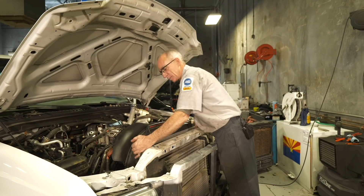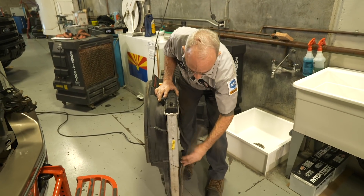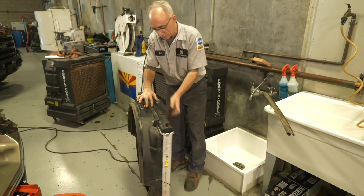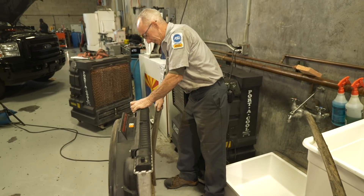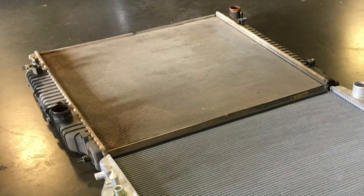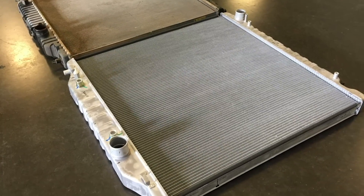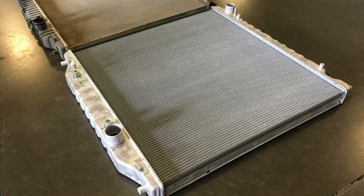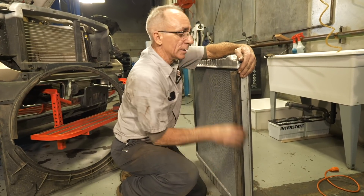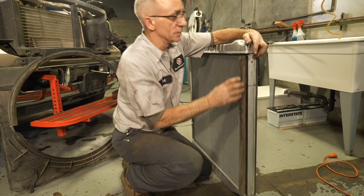We're going to upgrade our radiator — take this plastic one out. These seals right here, you want to make sure and get them back on your new radiator. You'll leave a real big air gap between your intercooler and the radiator otherwise, and loss of efficiency. The stock 6.0-liter radiator has plastic end tanks and failures are common. The upgraded bulletproof diesel all-aluminum radiator is a reliable and durable alternative. Let's get the seals back on — you have to kind of push them all the way on and then they'll roll into place.